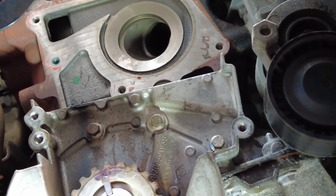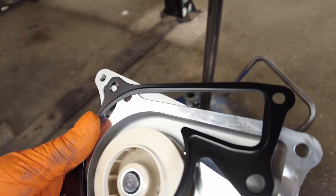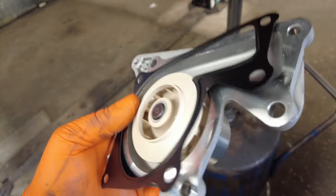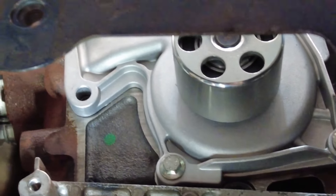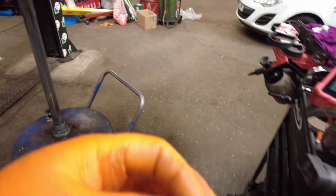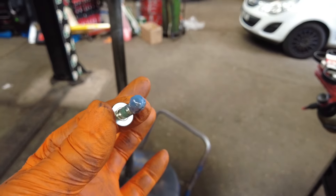Let's get that block cleaned up. With that block all cleaned up, it does look like brand new — let's get this water pump back on. All these gaskets: you see so many people using silicone — you don't need to, it can void your warranty. Just use the gasket. With all the bolts torqued up to 10 Nm, that one going into the water jacket — you need to get yourself some liquid PTFE and put it on the bolt because you don't want that leaking.